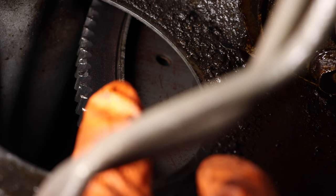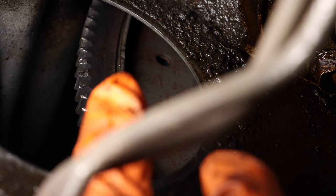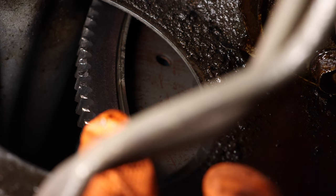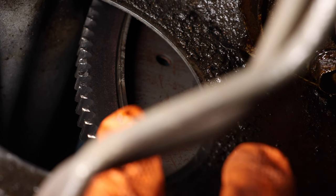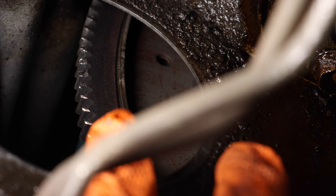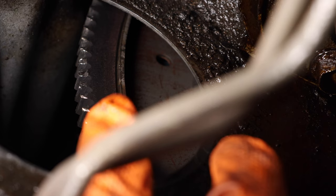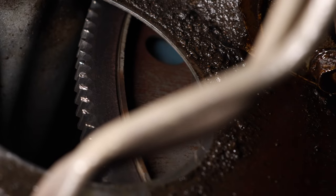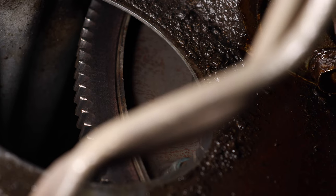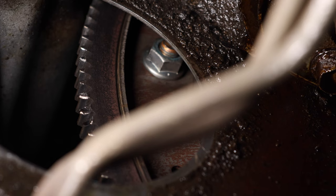So you can see here what I meant about damaging your engine. When the starter fails to engage properly and it just keeps spinning, it will effectively grind your flywheel or flex plate. If it grinds it enough, you'll actually need to replace the flex plate, which is a pain since you have to remove the transmission to do so. In this area here you can see it ground down my flex plate pretty decently, but I still have enough material where the new starter will be able to engage. And you can see that area there is pretty damaged as well.